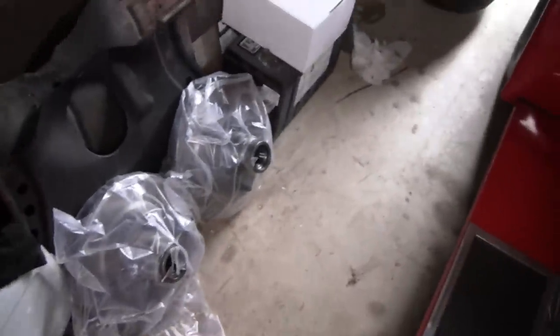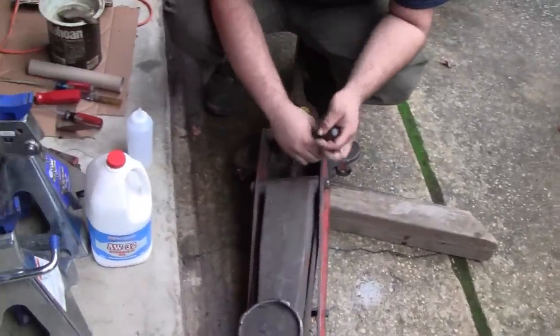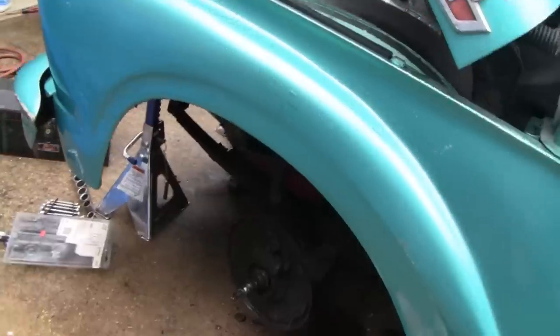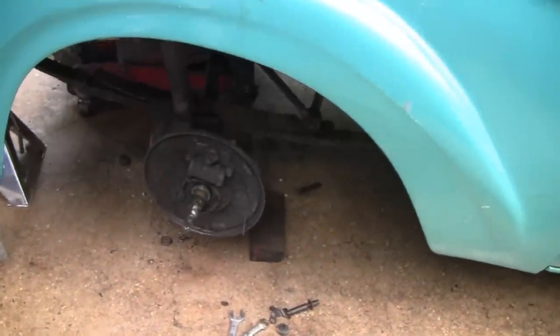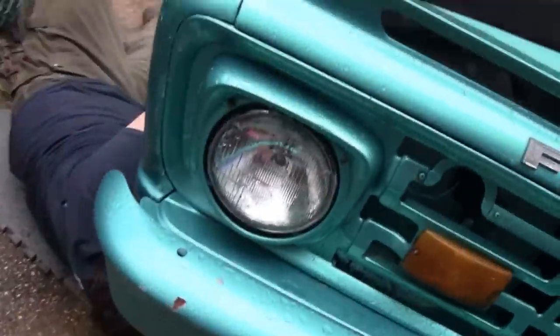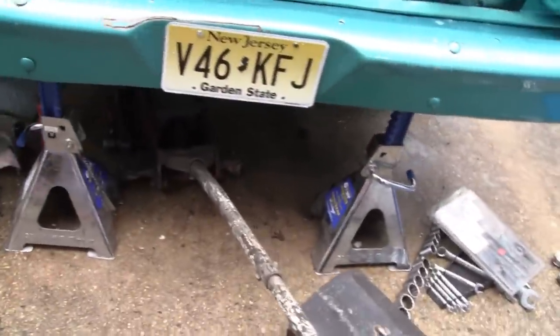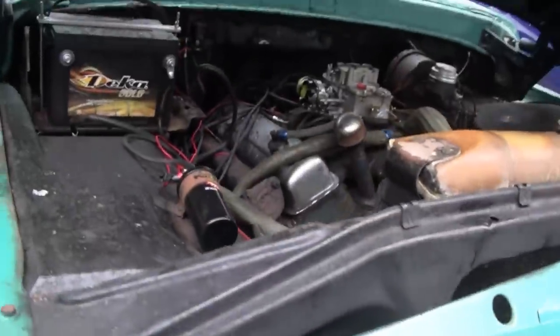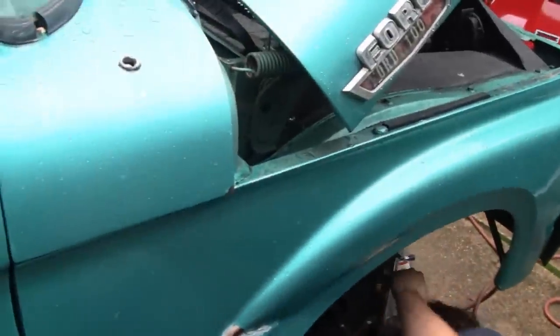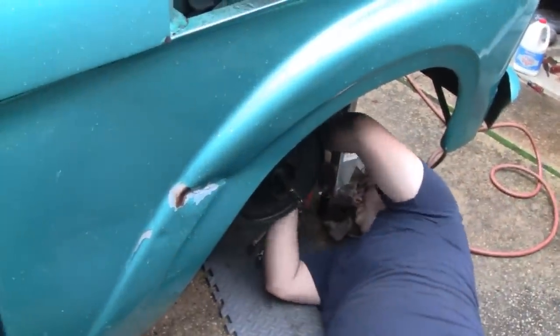So we're gonna try to take the axle out now. It's raining out but it's not too bad, just drizzling. The little dirt bike and daddy dirt bike should be coming over later to help. Mike's just about got everything disconnected under there. I took the drums off and the brakes off — we're not gonna need them, so it's less weight when we carry it in. He's taking the other leaf off on his side. You got all the tie rods disconnected? I took the drag link from the pitman arm to the driver side spindle. The tie rod for the two spindles I'm just gonna leave on there — we can take that off once we get it out. Gotta take the shock off and then there's the four nuts for the leaf spring. That shouldn't be too bad.